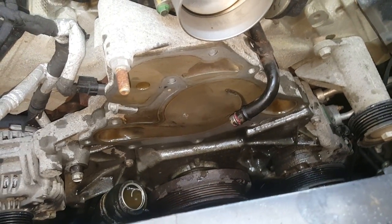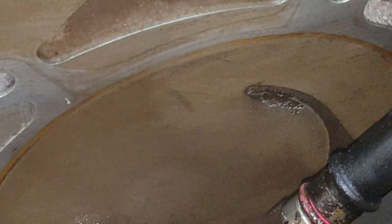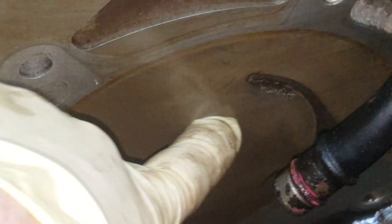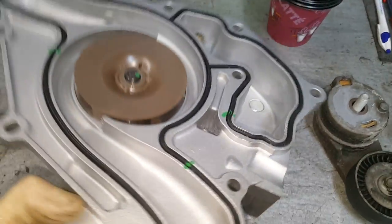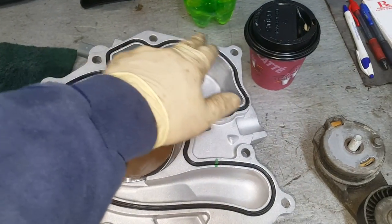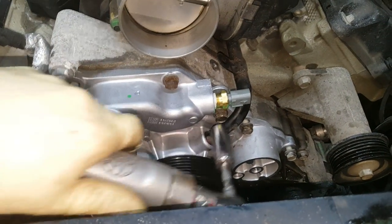As I was cleaning this up with emery cloth, I noticed we're starting to get a decent amount of pitting inside the timing cover. That's always something you're going to want to check when you do these types of jobs. Apparently they weren't flushing their coolant enough — it got acidic and started eating at the aluminum cover. This isn't bad enough at this point to where the cover has to be replaced, but if this water pump fails again, there's a good chance that may need to be replaced at that time. The water pump we have here actually came with the rubber seal pre-installed — if that's the case on yours, just run your finger all along it and make sure it's pushed down all the way.